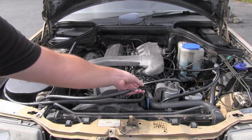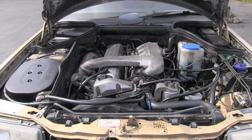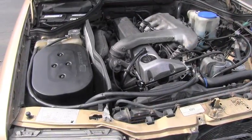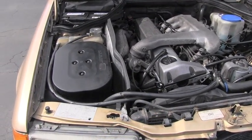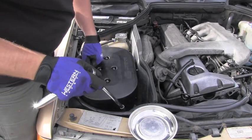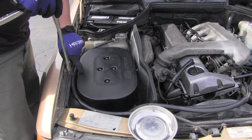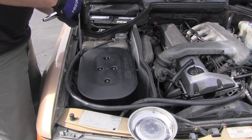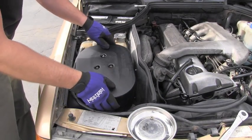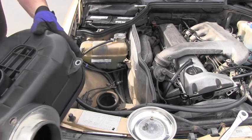I will be removing this entire part which are the hoses leading to the recirculating air valve transducer and also the EGR transducer. In order to get to those I will start with removing the air box. That should be pretty easy because so far I see only three 10 millimeter bolts here, here, and right here. Let's start removing those and I should be able to move that air box completely out, which actually happens super easily.